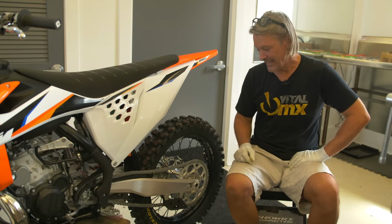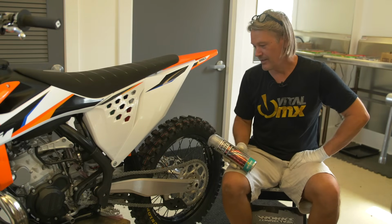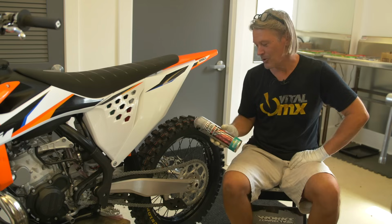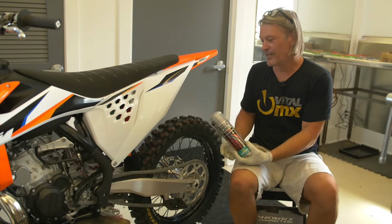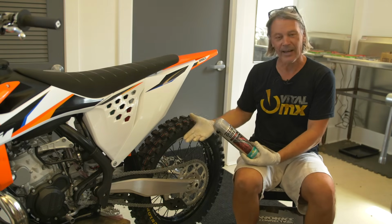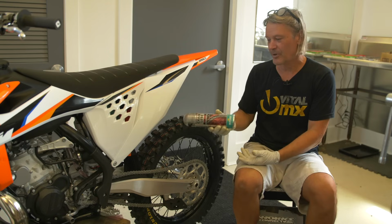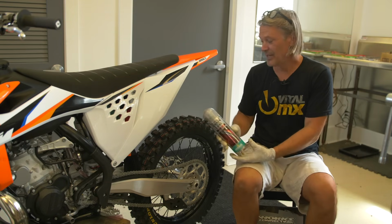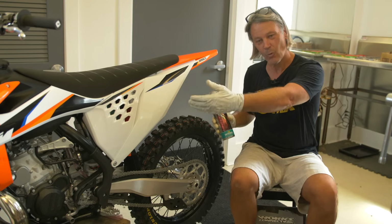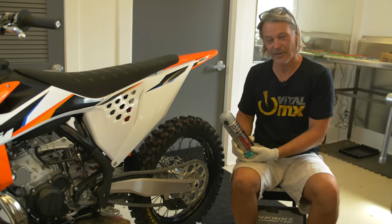Finally, the last thing is chain lube. Surprisingly, I actually spent maybe a few hundred dyno runs to determine this, but chain lube is worth about 3/4 of a horsepower. And so think of it as normally you would spray chain lube on, let's say before your first moto. And you may not put it on after your second moto, but a dirty chain and sprocket is going to lose about 3/4 of a horsepower. If you just apply chain lube, it's going to get that back. So something you don't think of, but it may be the difference between you getting 1 bike length ahead of the next guy. So that's something to think about next time you're at the racetrack.